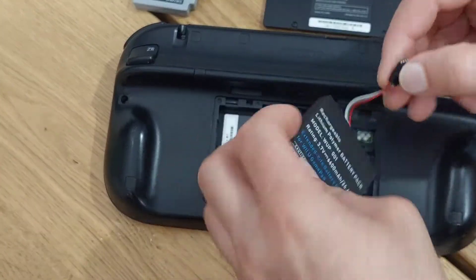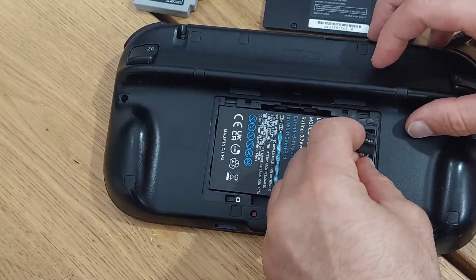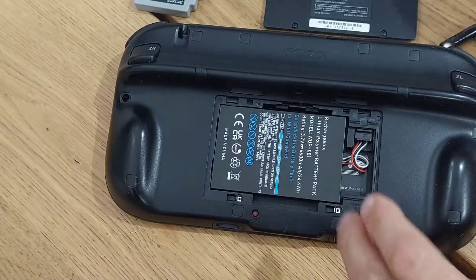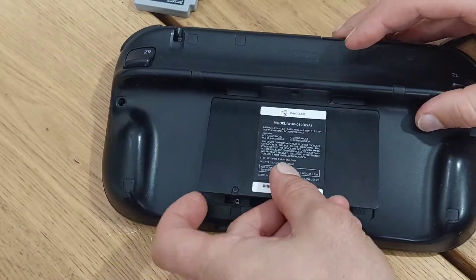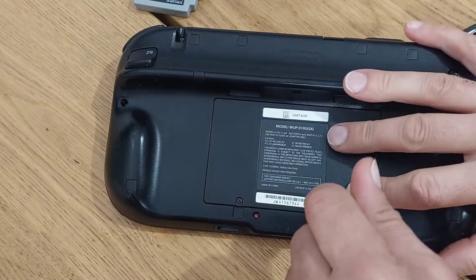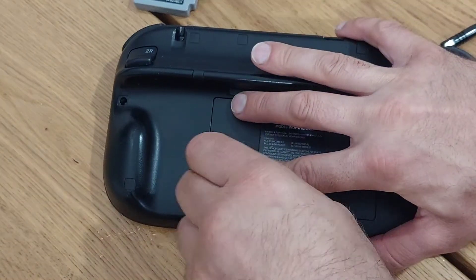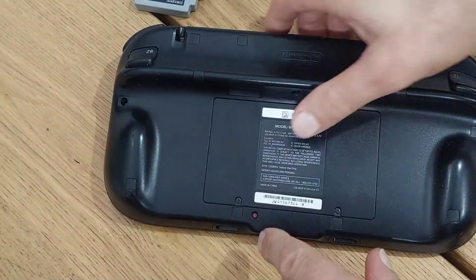And like I said it's a whole lot bigger. It just goes in there sideways, or anyway, wherever — it's like the biggest battery you can probably get for it. And you just click the connector back in. Put your cover on and tighten your two screws back down.